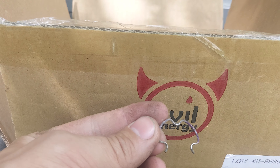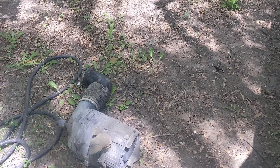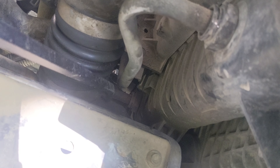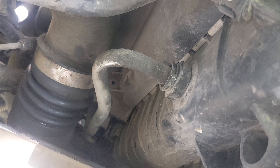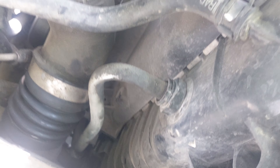Here's what that little clip looks like. I'll show you how this pops out. I did end up taking out the intake air filter assembly so I get more room. And now you should be able to see — here's where the transmission line comes out on the bottom. I will tell you now: if you take both of these out, the piece that's in here for the transmission cooler will drop, and I hear it's near impossible to get out.